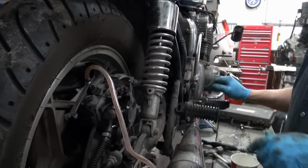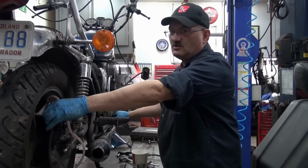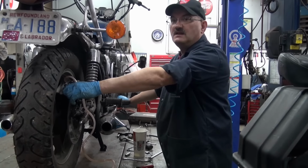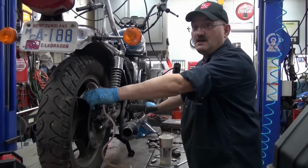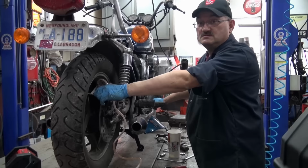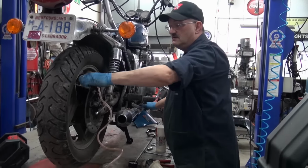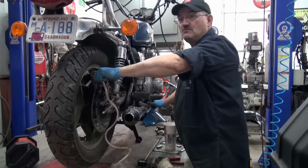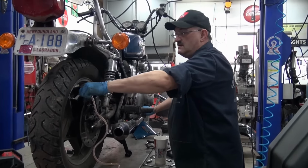Now that little vent hole that I was showing everybody a little while ago, that's basically what's going on with the Honda Goldwing. Really? With the back brake sticking? Yeah. That little vent actually got contaminated. Wow. And technically, it's not Honda's fault, although they're looking after it. It's lack of maintenance on the owner's part. Because they're not changing their brake fluid. It's just moisture getting in, and it's corroding the aluminum.